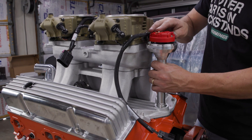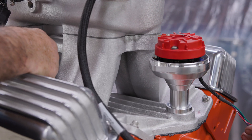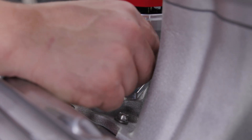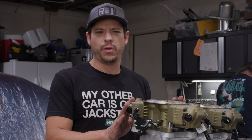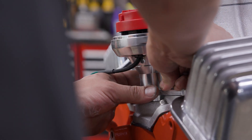I'm going to stab the distributor in right now. It's a Holley Dual Sync — really great because they use a cam sensor and a crank sensor inside the distributor. If you want to run sequential fuel injection, you can. For this, we're probably going to do batch fire. It's not going to really matter in terms of our ultimate horsepower, but that's the next step. Then I think we can put this thing on a cradle and get it to the dyno shop.